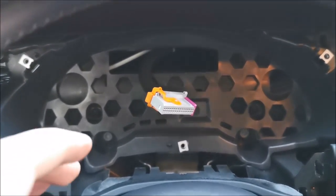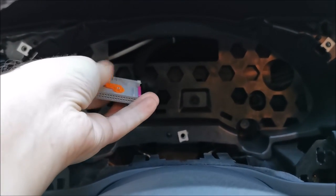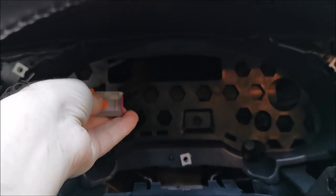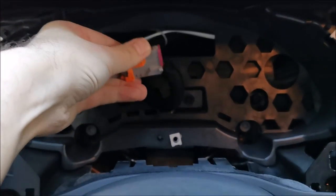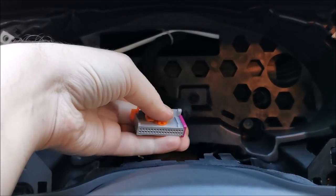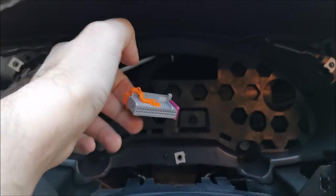The second time is the lucky one. When you put everything back together, make sure this cable starts to go into the hole from which it came out — do not try to tuck it in sideways or you will break the connector. Make sure it starts to go in properly, and hopefully all is well.